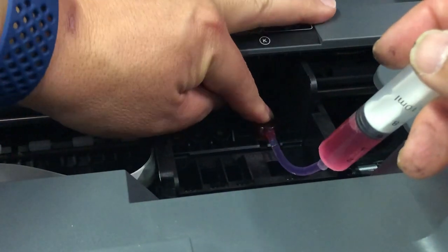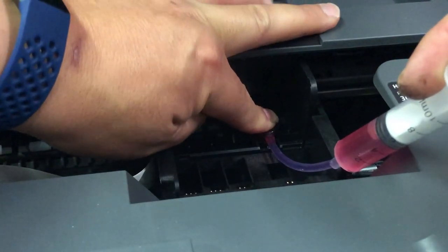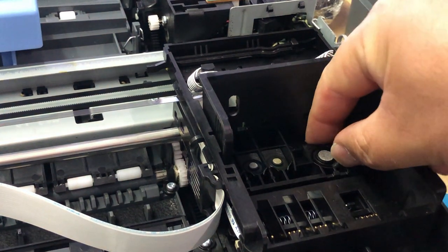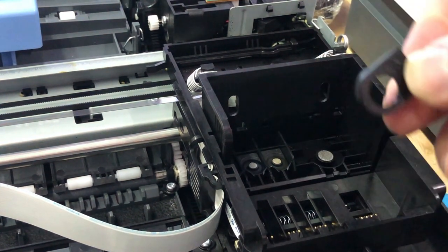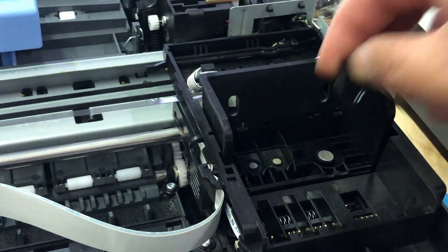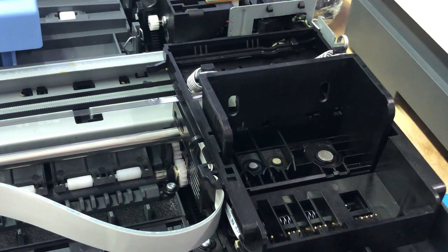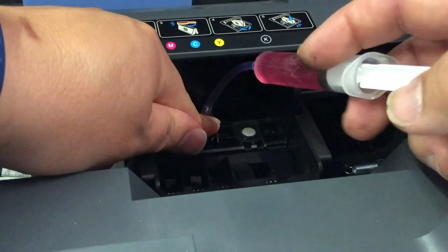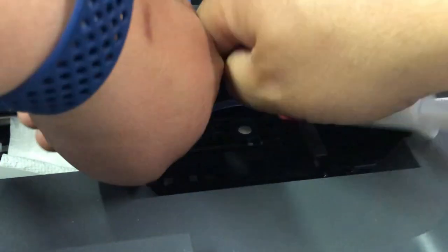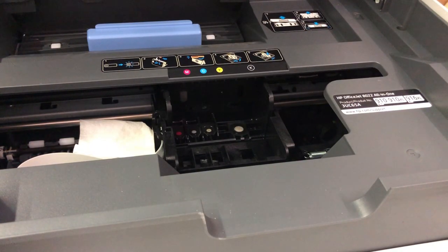Your left hand should push down the tip evenly with even pressure. If you don't have even pressure, you're going to see the juice come out all around it. This black washer is sandwiched between your tip and the base — you need to stop leaking from both top and bottom, which requires even pressure. Now switch to the smaller tip for the rest of the colors. Your goal is to put some red cleaning solution inside the printhead and leave it there — not to totally flush everything out.